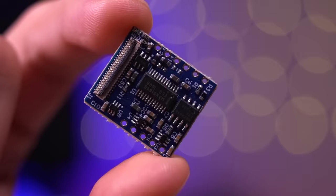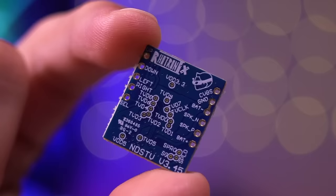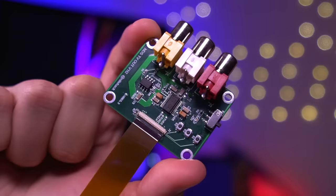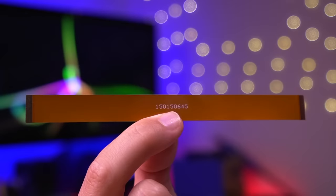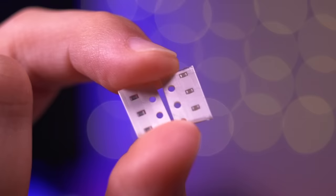The first thing in this kit is the custom PCB. This is what interfaces the DS Lite console and outputs the video signal to the headphone jack. It's quite compact compared to the original board designed by Nighthack of Lost Nintendo History. Also included is a rather long ribbon cable which connects the DS Lite's upper screen LCD connector to the Rotronics PCB.